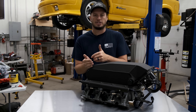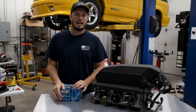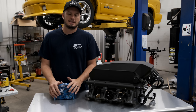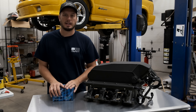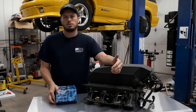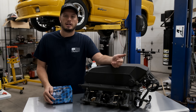We typically see a 30-degree rise from the beginning of the run to the end. That 125-degree intake air temp is important because it lets you understand how much timing you can safely run. If you start getting into 200-plus or 160-plus degree intake air temps, you're getting into the dangerous side of timing and what the fuel can handle regarding detonation. We're running almost 2,000 horsepower on this Gen 5 LT Nova and this intercooler does great.